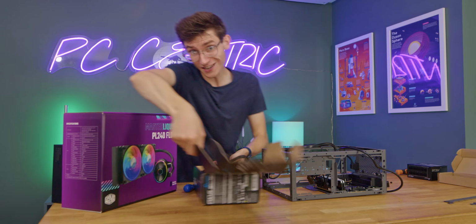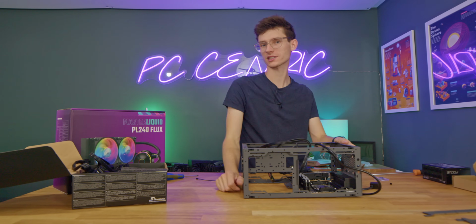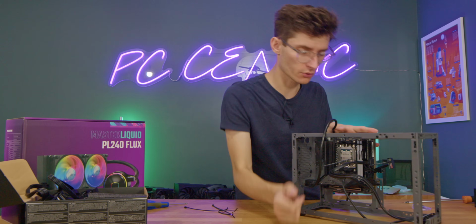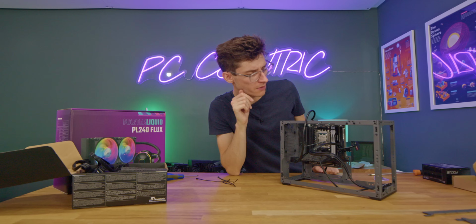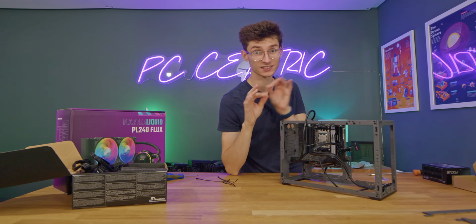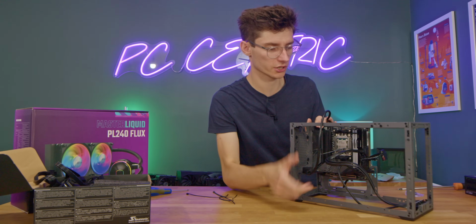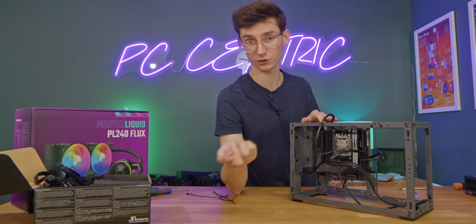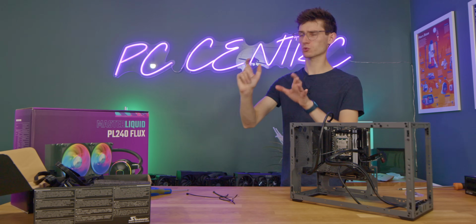You will regret it. And interestingly as well, actually, you can use an ATX power supply. So that's the full size one inside here if you so desire. I wouldn't actually recommend that though, because obviously it will take up more physical space, and this is not so good for cooling and cable management and actually fitting everything in. But then also something a lot of people don't realize is in terms of the cables, ATX cables are of course much longer, and this is a very small enclosure. So if you are going to use ATX, I would suggest getting some custom cables made that will be a lot shorter, or I don't know, getting hold of some, which is the same as what I just said. Do you like repetition?